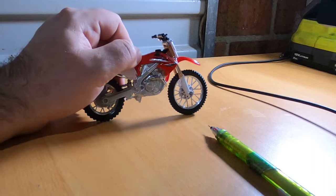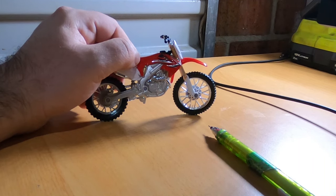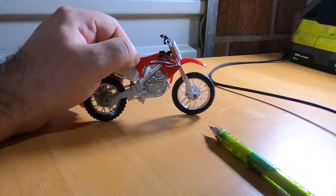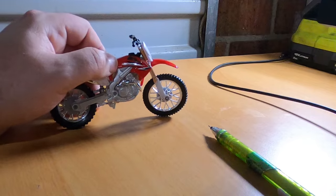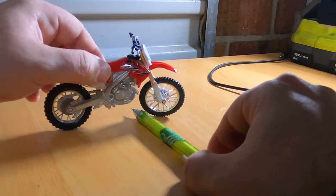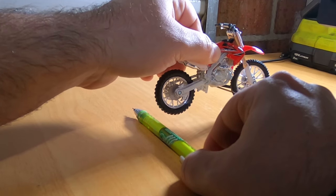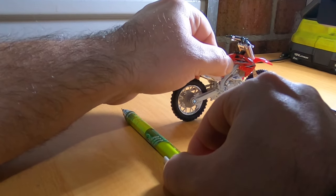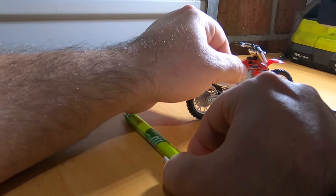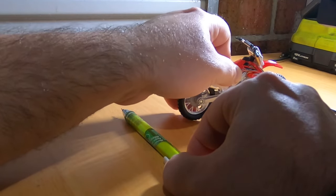So having explained that, why do people say that when they've added preload to their suspension it feels hard — or it feels harsher? That is because when you're riding you get a bit of weightlessness. You hit a bump and now there's no weight. The non-preloaded spring will take some of that force on its way down, whereas the preloaded spring will have a bit more of a jolt.